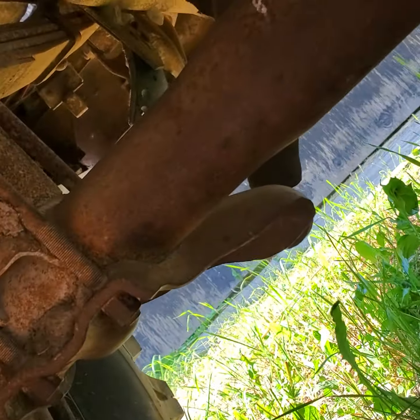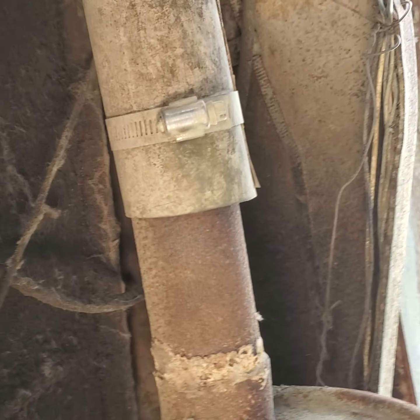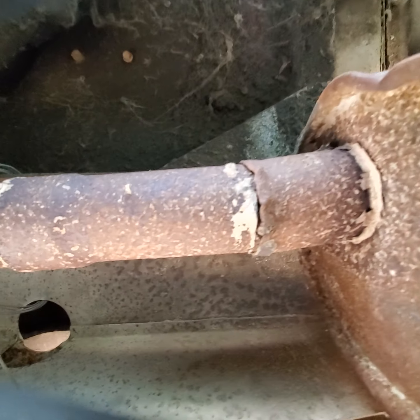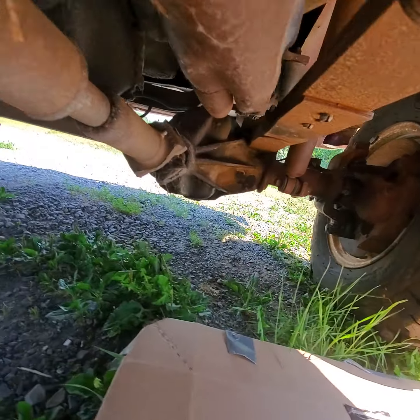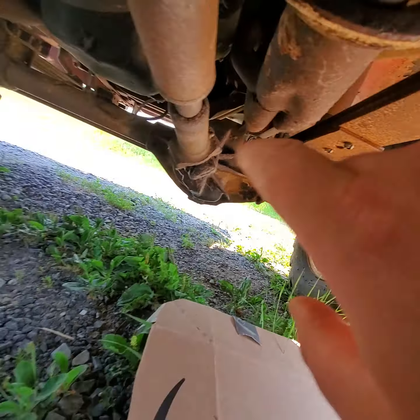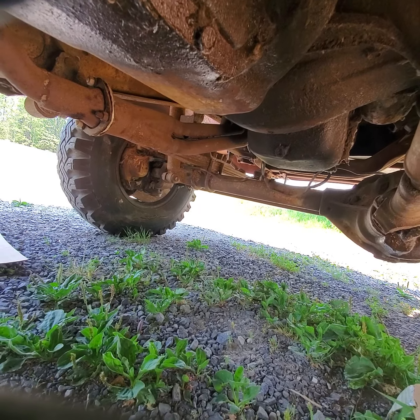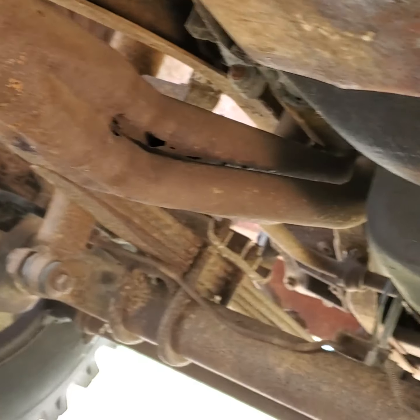I have work ahead of me though, mechanically. The exhaust is rotten there. He's put in a stupid, horrible camera work, sorry. There. And then, he's got this sectioned in, and then the headers, it does have headers. It is a 318. And this header has a crack up there that I'm going to tack up. That one has some, you can't see it on this side, maybe zoom in. That one has some pinholes in it that I'm just going to tack up, right?